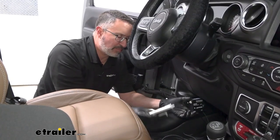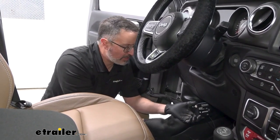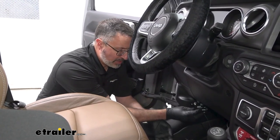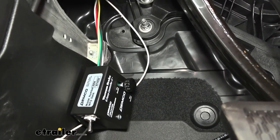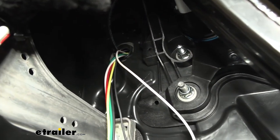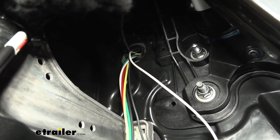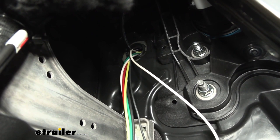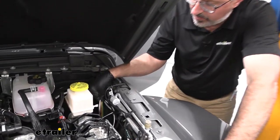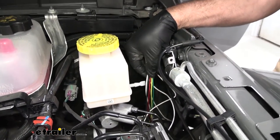The other two main components are the pedal piston — this goes on your brake pedal arm to actually push the pedal down — and the G-Force controller, where you can turn it on and off, mounted on the kick panel. It's easiest to have the G-Force controller on the inside of the footwell and run the wires through the firewall. On these automatic Jeeps there's a grommet you can pop out, drill out the inside, and run the wires through, then seal it up with silicone.